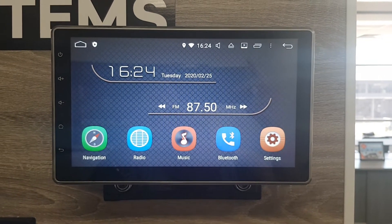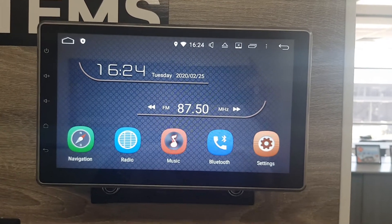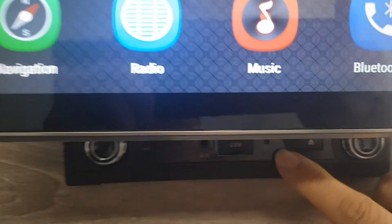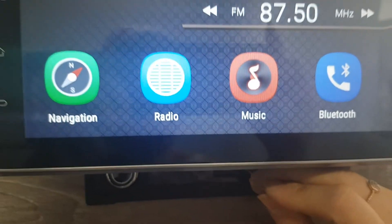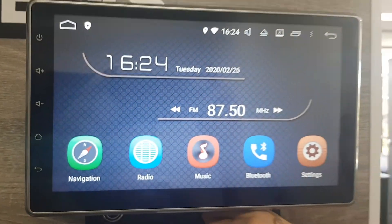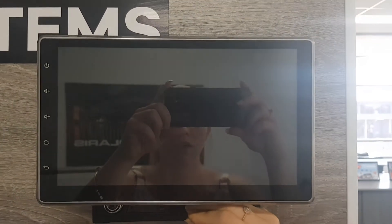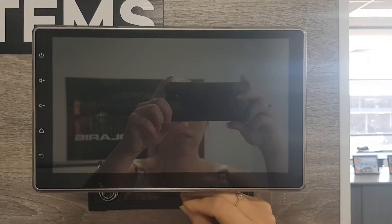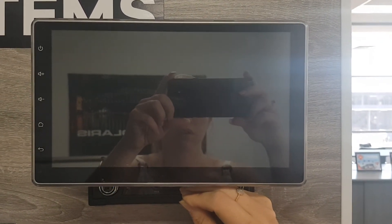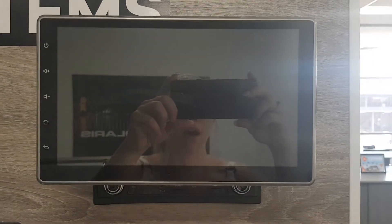On the Universal Max you'll find the little reset hole underneath the screen, near where all the knobs are — just there. What you need to do is hold it in, and watch the buttons on the left-hand side. Once you see these flashing, you can release the reset hole. Wait for it, then release, and that will do a hard reset.